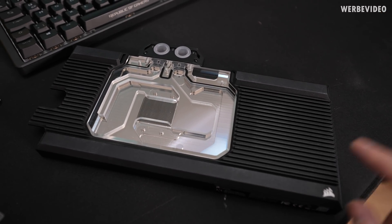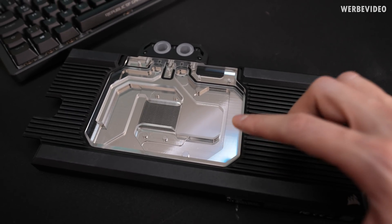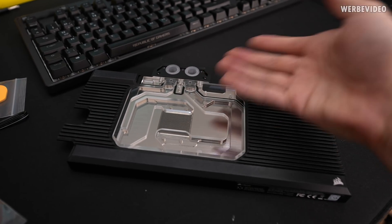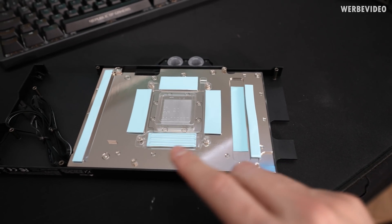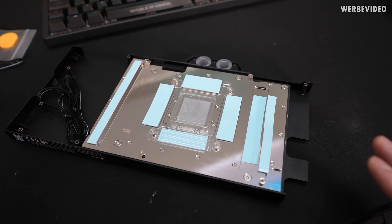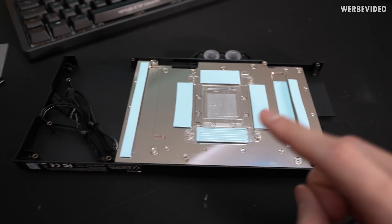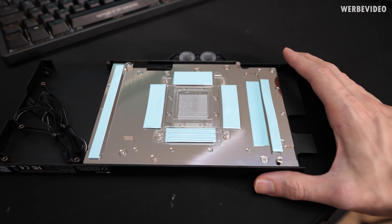The Corsair water cooling block is made out of three or four materials. The outer part is black anodized aluminium, the cooling block part is nickel-plated copper, and then we have some acrylic parts and a plastic cover on the back which looks nice. What I like the most about Corsair blocks is that the thermal pads and everything are completely pre-installed. Especially if you're new to custom water cooling, this is the absolute best feature — you don't have to worry about whether it's a 0.5mm or 1.5mm pad or if you're placing it in the wrong position. I wish EK and all the other manufacturers would do exactly the same. There's a protective cover over the thermal paste, so you just get it, put your card on top, and mount it.